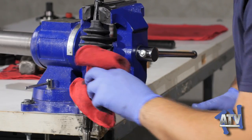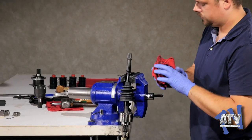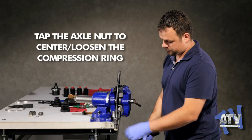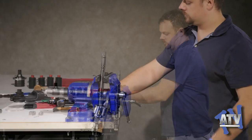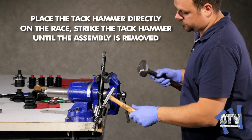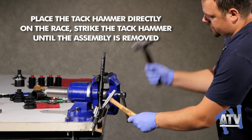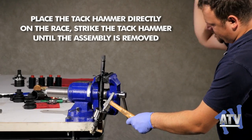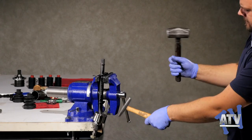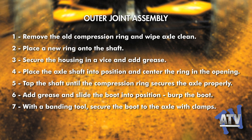With the joint facing down, leave the outer nut on but sticking out beyond the edge of the threads. It can be most helpful to start by tapping the outer nut with your hammer. By doing so, the inner ring will tend to center itself around the shaft, making the joint removal possible. Bend the joint away from you, exposing the inner race or star-shaped piece. Hold the tack hammer on the exposed race and strike the other end of the tack hammer instead of striking the joint itself. It's important to begin with light taps that help center the compression clip before increasing the intensity of the blows. Eventually, the joint will come off.